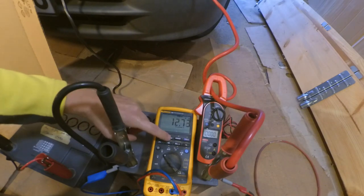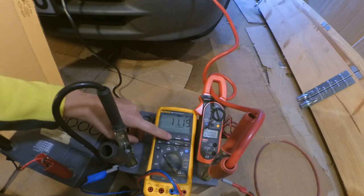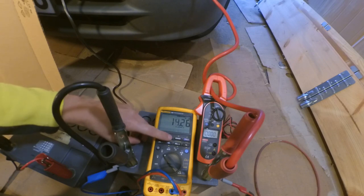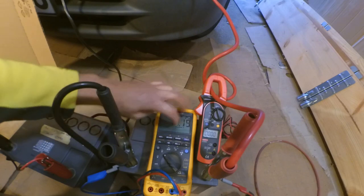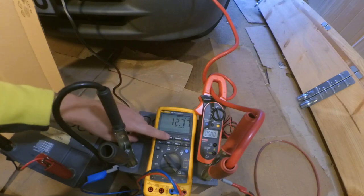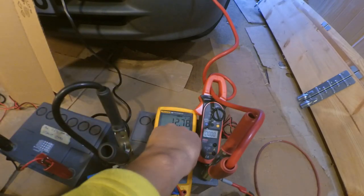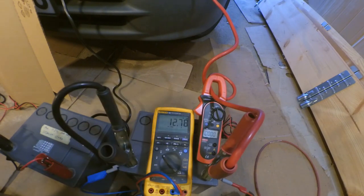So the reading on this battery comes maximum 14.26, minimum 11.19, and then I had pulled some current before testing the lights and so on, so it's okay. And average. Yeah, so this min max is really handy. Yeah, you can see it go down here when you do it, but sometimes you don't have someone watching, and this min max really records the lowest, so you get a more accurate reading. And you just reset it by turning it off and then activate it again like that.